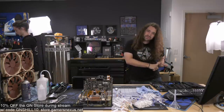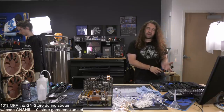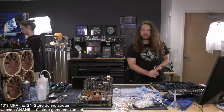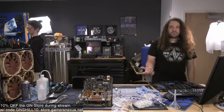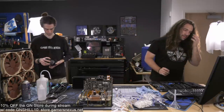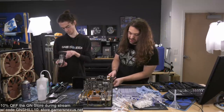The age of the paste is a problem too. There's not really much of a curing time, but there is a shelf life of thermal compound. Also run-to-run variation. Thermal paste will be slightly different each time, so that's a problem. But mostly you just don't have enough accuracy.